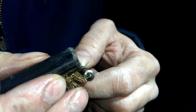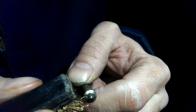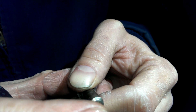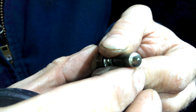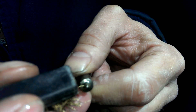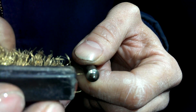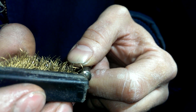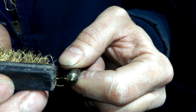You can see it does not want to go into the one that's dirty. That one went through. Carbon can be so tough — that head I had to clean with actually a blade a little bit. I was very careful, wasn't putting a lot of pressure. I soaked it in quite a few different liquids and still did not clean it.